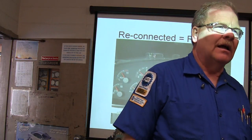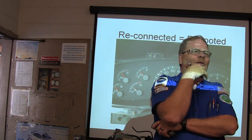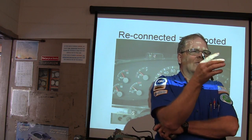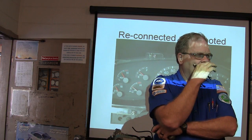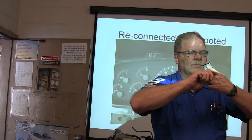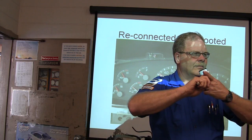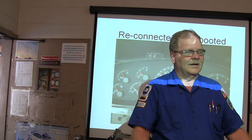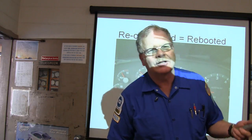Now what you gonna do? I don't know how many times I've unplugged something, plugged it back in. You ever seen these things where somebody would send me an email and they say, my Dodge, a bunch of the electronics aren't working, door locks, whatever, speedometer, instrument cluster, and all that kind of stuff. And I said, what you're gonna do is you're gonna pull both battery cables off and touch the battery cables together. And that empties all the capacitors and lets the computer forget any trash that may be in its memory. And you put them back on there, and about half the time all that stuff will wake up and start working again. And I've had people who say, hey, that took care of it.